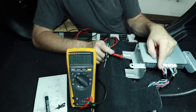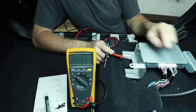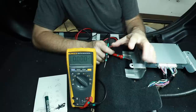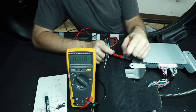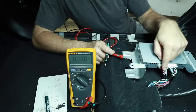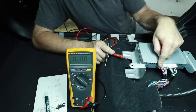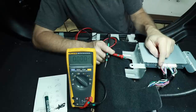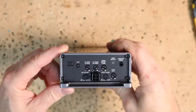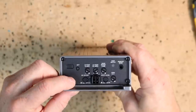Though it's 3 volts, not all amplifiers will take a 3-volt DC offset trigger. Fortunately for us the Kicker KEy will, but I like the idea of having a dedicated on-and-off 12-volt circuit — I feel this one is probably going to be more reliable. So in this case we're going to be using the 12-volt trigger at the amplifier, so we don't need to turn the DC offset on. In is on, out is off.